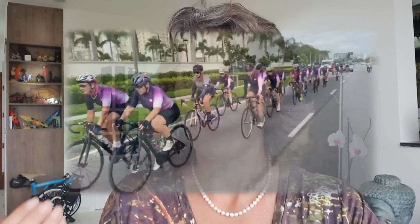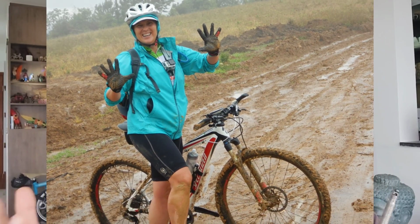I have to confess, I really like this valve. But that's particular, just because I'm so used to the road bike and the mountain bike. They all use this valve, and because of the high pressure, you can tighten it up and the air stays longer than it would in a Schrader valve. Okay, but there's a catch. The hole in the Brompton rim is made for a Schrader valve, and this valve is a lot thinner than a Schrader, so you do need an adapter so it won't be loose.